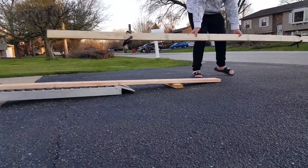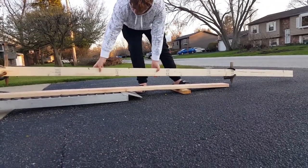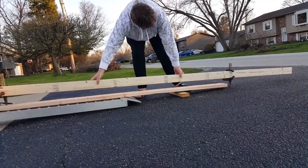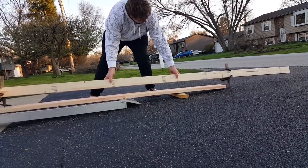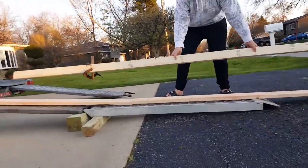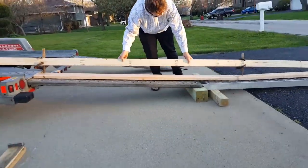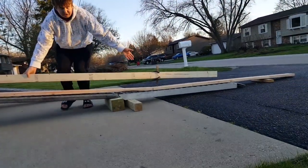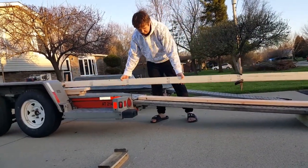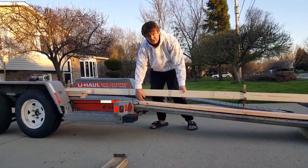As we keep going up, you can see that what simulates the rear bumper — or the front, since we're dragging it up backwards — even at the worst-case scenario where we put it right here, the wood raises a bit, and we're going to be clear in the front by the time the rear wheel hits. The front bumper is completely fine. We keep dragging it up and the front bumper is still fine. Further up, we're still clear. At our final problem point, which is actually in the center, we're worried about bottoming out — down here is still only three inches — but we don't have an issue; we're perfectly clear.